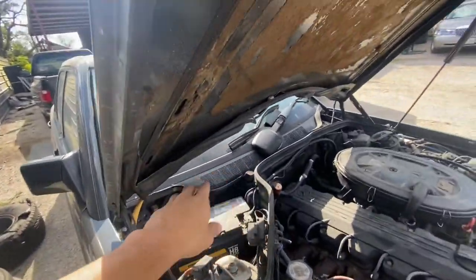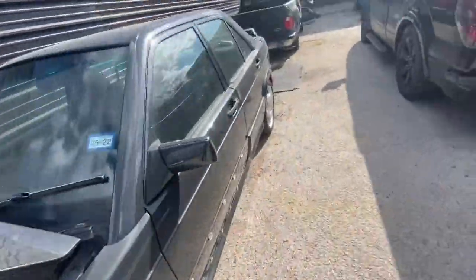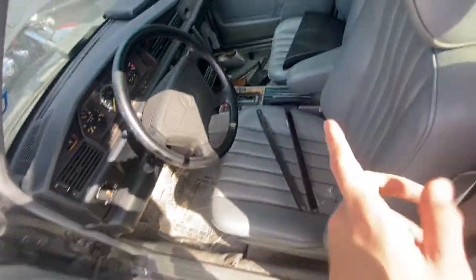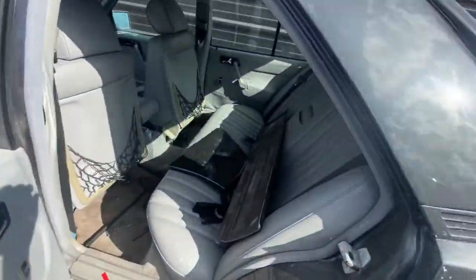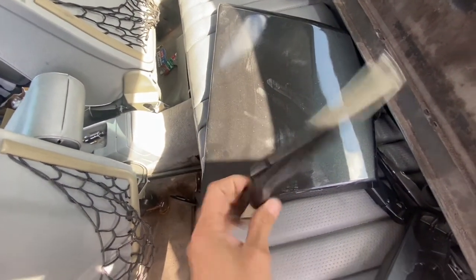What I'm going to do right now is focus on re-wet sanding this panel and then the windshield wiper arm — this piece is going to get color matched so I have to remove it. There are some trims that go under the headlights — these right here — which will also have to get color matched. These are the OEM bolts that hold them on. This is the trim piece I'm going to repaint. This car does have headlight windshield wipers which I think is pretty dope, so we'll have to install those onto the trim pieces. I'm going to install them first and then paint so I don't damage the paint.